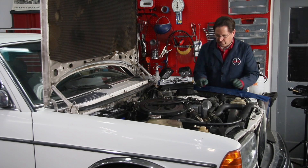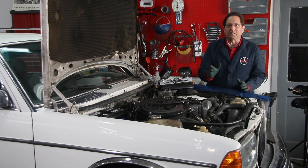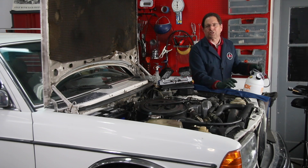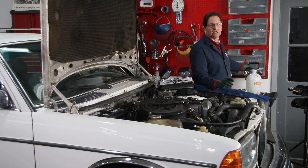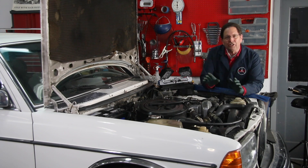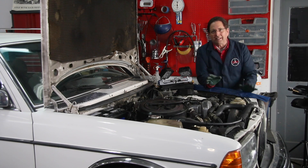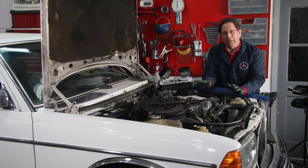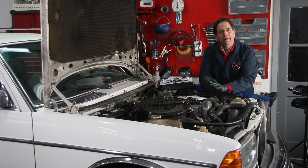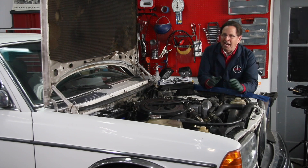That's why I came up with what I call the high pressure method. Instead of pushing the hand primer pump, I use a pressure tank — the same one I use for brake bleeding — to pressurize the fuel system. This gives you a constant pressure in the pump so you get a steady drip at one drip per second without having to sit there and pump. You can set the pressure up so it's dripping steadily.